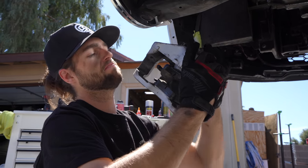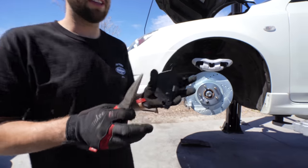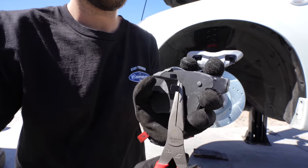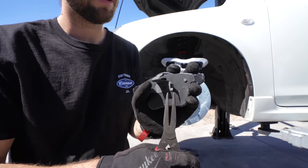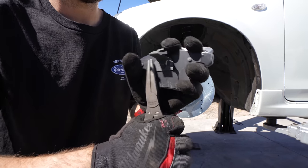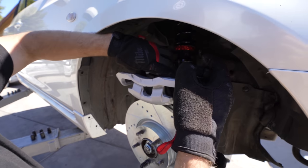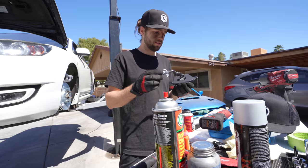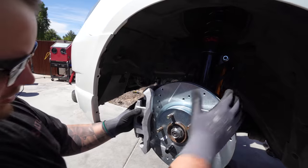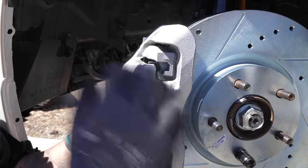It's fun — great time. These are a little stressful to push into the piston. On the side closest to the engine on both sides, I'm going to grab it at the base and pry it in so it's less of a drastic angle. Once these things are in there they're in there. Making the angle a little less dramatic makes it a lot less frustrating — mainly these side ones. Got it in just like that. These little tabs on both sides of the caliper bracket — you want to line these up.